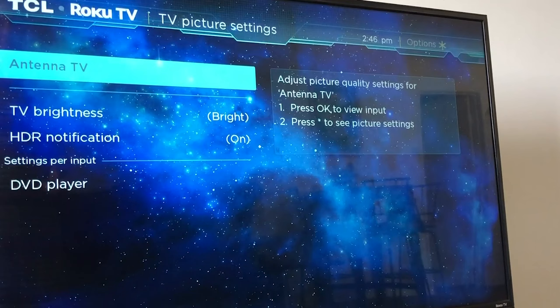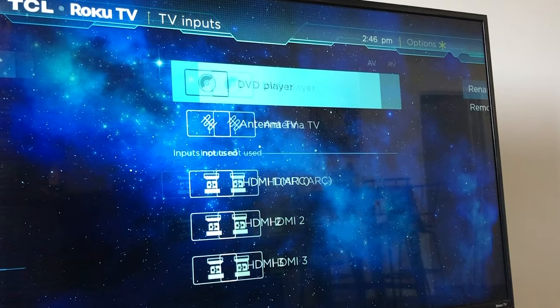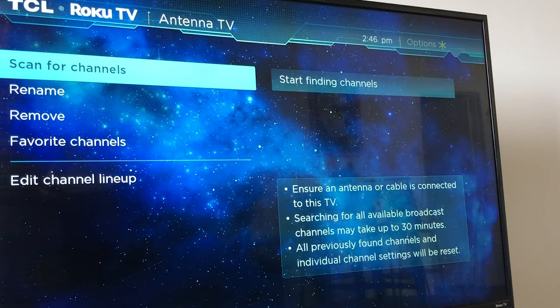Once your antenna is screwed in, the next step is scanning for channels on your TV. Turn your TV on and go to the settings area. Every TV is obviously different, so look for something like 'Channels and Inputs,' 'Channels,' or 'Set Up TV Channels' and select that. From there, find the cable/antenna output option and select antenna. Then select auto program mode — it will tell you it will search for channels. Select OK. This will take several minutes, so let it search. Eventually it will start finding and showing you all the channels in your area that you can pick up. After that, go back to your TV home screen and select the TV option from your menu to start watching your local channels.